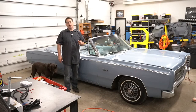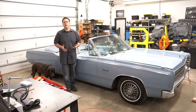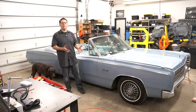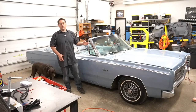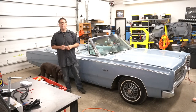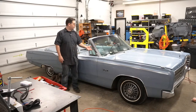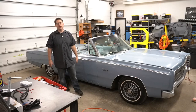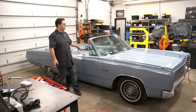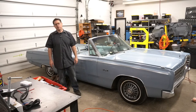All right, so I think we're pretty much at a stopping point for our video because we've got our RediRad installed, we've been able to test it out, and we see that it's working. And really, the purpose of this video was to show you an option for getting modern audio onto your actual AM radio by using an AM modulator from RediRad. So pretty cool piece of kit. And sure, we talked about other options. You could swap the radio out, you could do a whole hidden system, but I'm gonna be real excited to drive this thing with the sound from the old speakers, the sound from the AM radio, but actually having some cool music to play while I cruise.